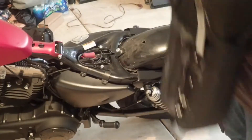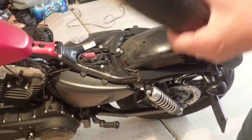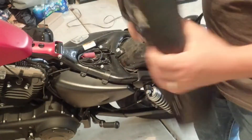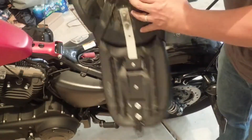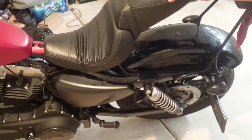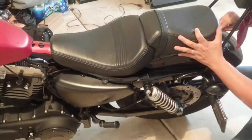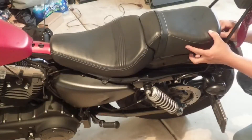For those of you who have not removed or put back the seat of a Harley, this is very simple. This is the original Harley seat — I just added a passenger seat. To put it back, there is a tongue here that you just need to insert in the front. At the back there's a big bolt that you need to align into the hole. The technique is: put the tongue in, push it in, then look underneath — make sure the bolt goes inside the hole. Once it's inside, pull it back and then put the screw in. That's how simple it is for the Harley seat.